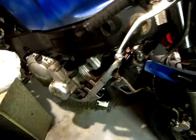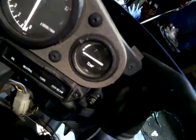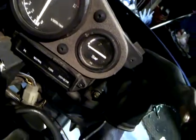So a quick drain, and then I put in tap water, and ran it, I don't know, about 2 miles on tap water, and then flushed that out and put some new coolant in. I did the same thing that got it to red, basically leaving it in low gear and just driving around, overworking the engine and underworking the airflow over the radiator. I didn't even get past more than 30%.